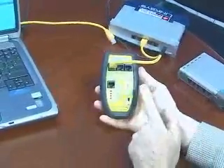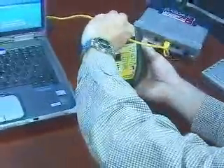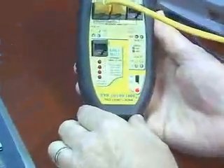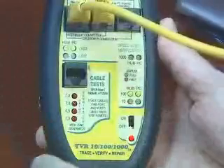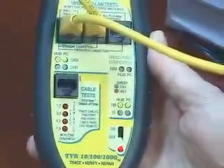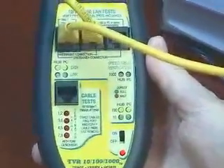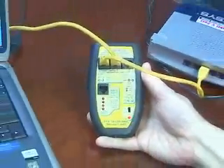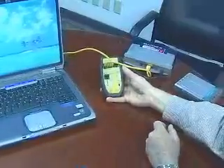Now watch this. I'm going to connect this gigabit LinkSys switch into my notebook, which we know is only capable of 100 megabit. I'm going to use the center socket for a straight-through connection; if I use the right socket, I'd be creating a crossover connection. The TBR1000 tells you what the final negotiated speed is in this link. It says that one of the devices is configured as a hub, the other is a PC — which is what you'd expect — and they negotiated to 100 megabit full duplex. This is extremely powerful because you can test this device and that device, but unless you can go inline, you really don't know what the devices ended up negotiating for speed and duplex. The TBR1000 makes it very clear.